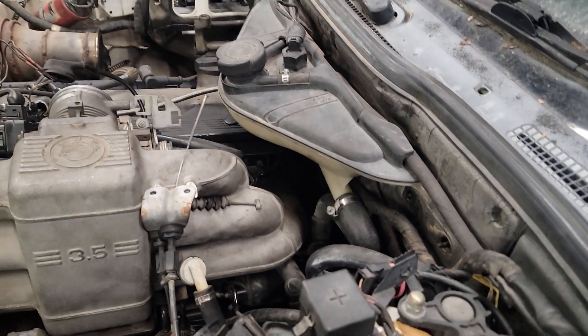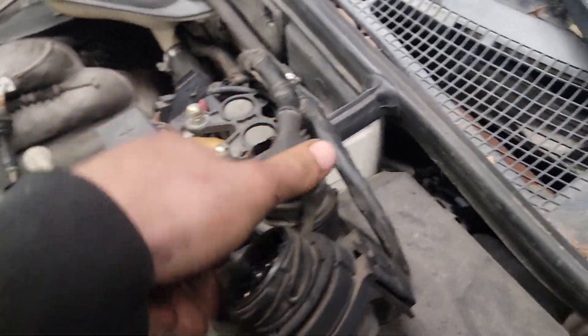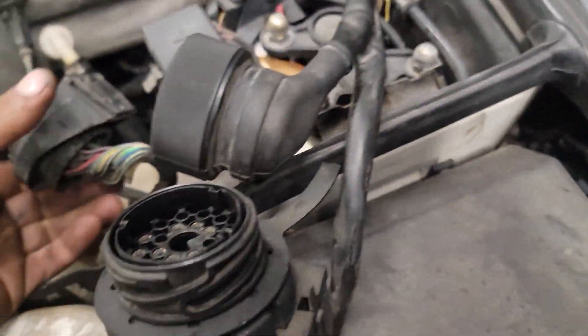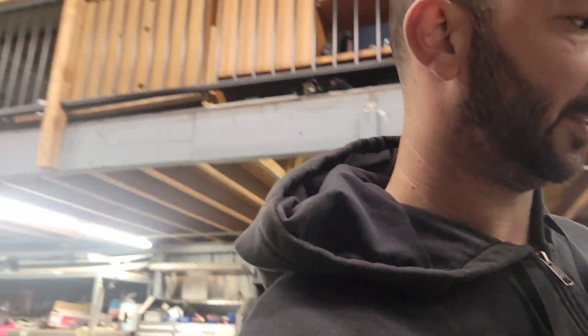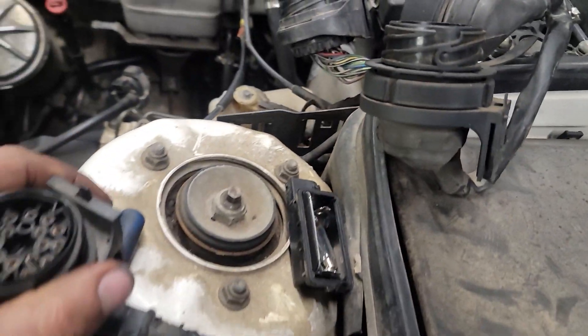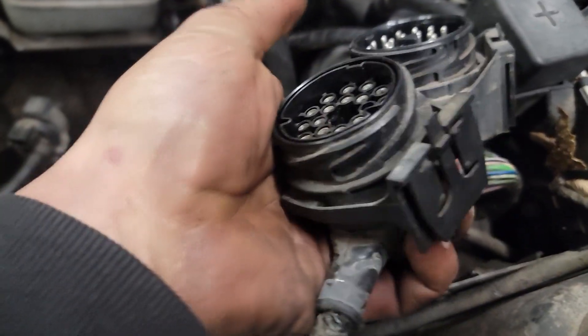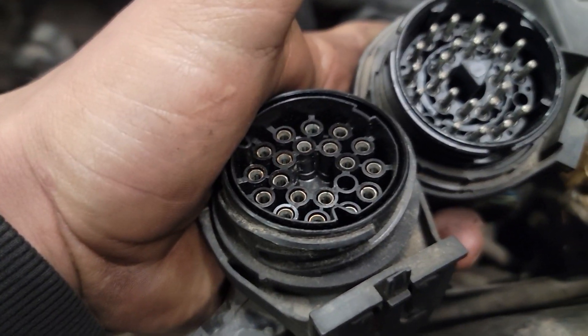I've been working on some stuff — got all the heater hoses in, expansion tank on, fuel lines done, and starter's on. I went to start working on the rest of the harness and this plug right here doesn't fit into the chassis plug. Apparently at some point they switched over from the E30/E28 style plug to the E36 style — I knew the M50s had that but I thought all the M30s would have the same harness. I went and cut this one out of the black car. I assume all those wires are going to be the same, so I'll do a little wiring work and replace this plug with the correct one.